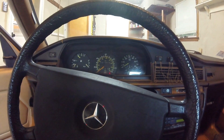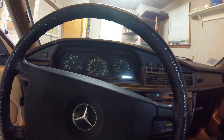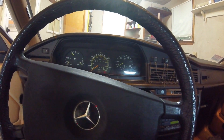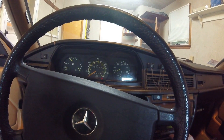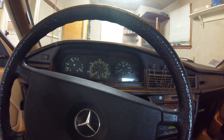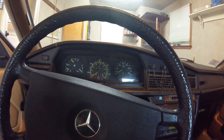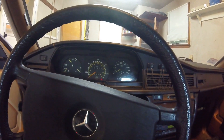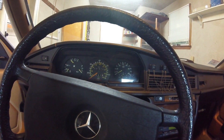I just pulled the car back into the garage after running those vacuum tests. Honestly, that opened up more questions than it did answers. I don't know if the vacuum system should hold a constant 20 inches of pressure, or if it's okay that it fluctuates between 10 and 20 depending on how much you're revving. If you have an answer, go ahead and put that in the comment section, because I'm going to have to do a lot more research. I'm not really familiar with these complex vacuum systems — it's not very common on modern cars. I'm hoping I don't have to get a new pump since they're not exactly cheap. Thanks for watching and I hope to see you on the next video.